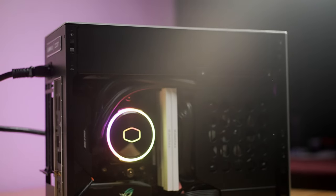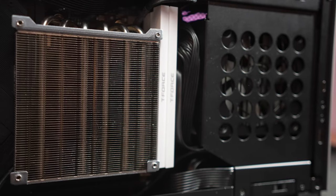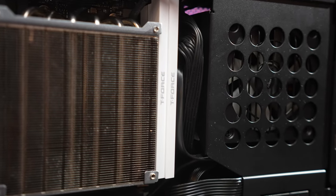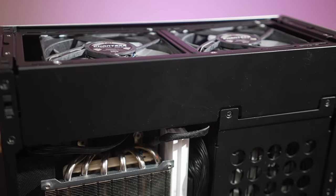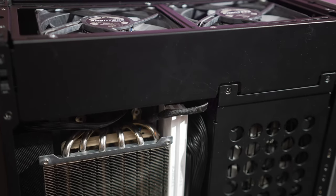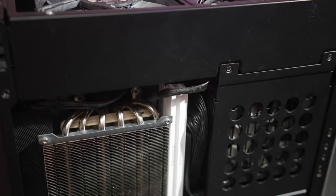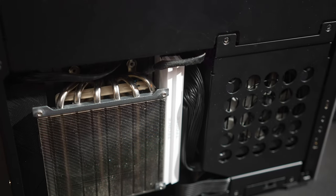When the specs are so tilted in favor of a 240 rad, in most cases you really are better off just going that route, and 55 millimeters is super thin territory. I grabbed the IS60 EVA — you guys know I really like this heatsink — because it comes with a 92mm fan on the bottom and a slim 120 on top, but the fan-on-top configuration is much too tall for this case. So I'm just going to swap out the stock fan for the Noctua A9x14 fan underneath, which keeps it at roughly 50mm height.